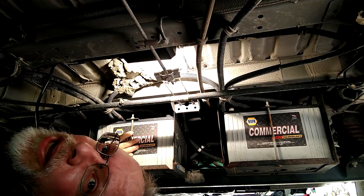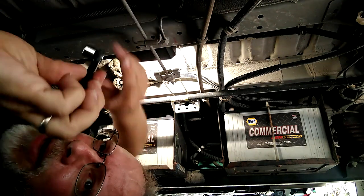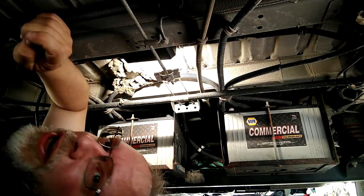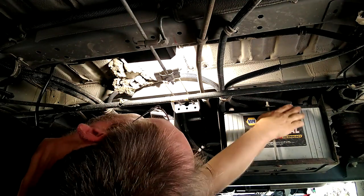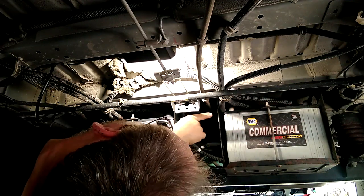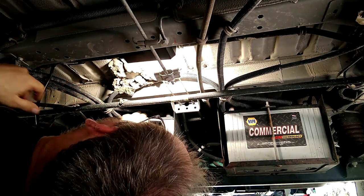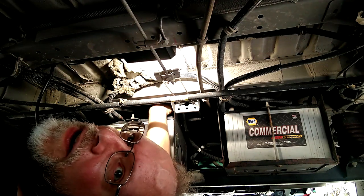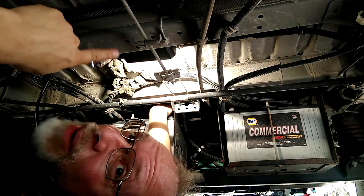When removing the batteries you need a half-inch socket wrench. In my case I've got the handle covered with electrical tape so I'm less likely to short anything. Here's the trick: start with the ground. The grounds are on the right side of the batteries looking backwards at the face of them, looking towards the tail of the vehicle. The positives are on the left side. There may not be anything on the front of the battery only on the top, so you kind of have to be careful.